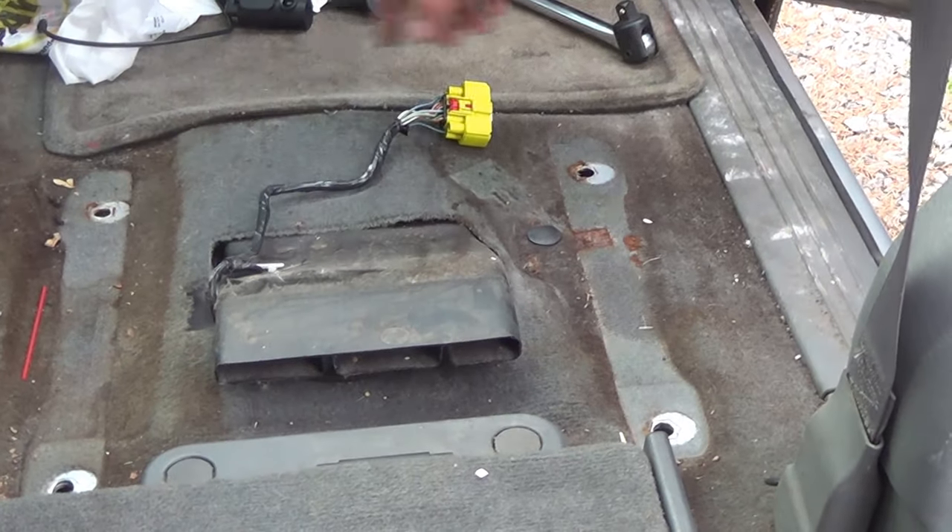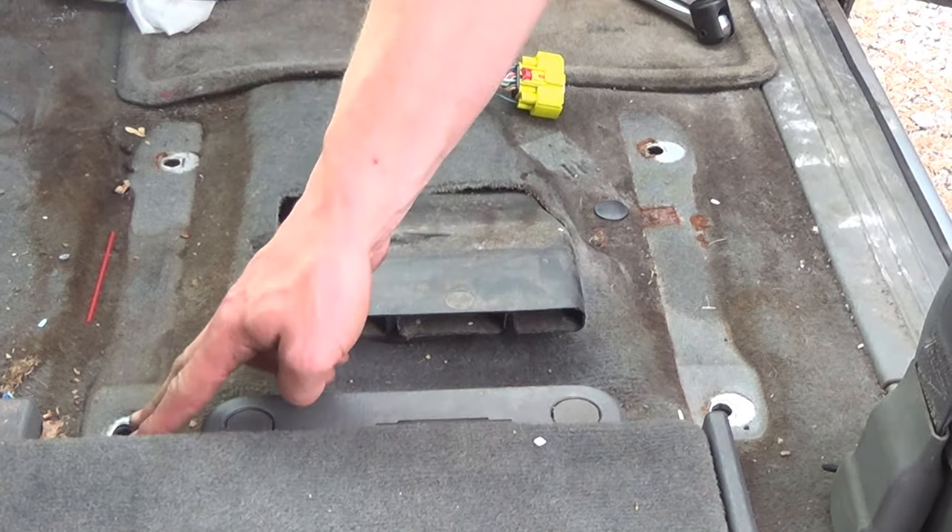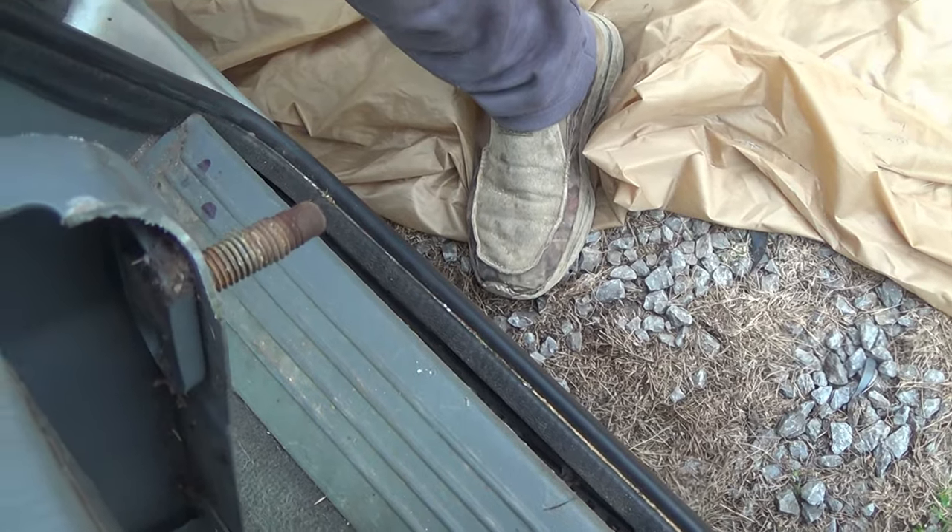But the more I sat there looking at the holes in the floor, I noticed they looked like they were pretty much in a straight line - which you don't always run into with a vehicle. So I thought, why can't I just flip the seat and mount it backwards? If everything lined up, which it looked like it would and it did, with the exception of part of the plastic around the base that wouldn't sit flush - just a little bit had to be cut off and ground off, and then the seat would sit down perfectly and bolt back down.